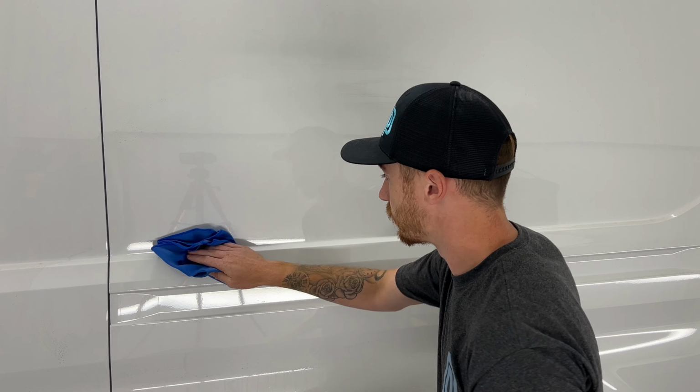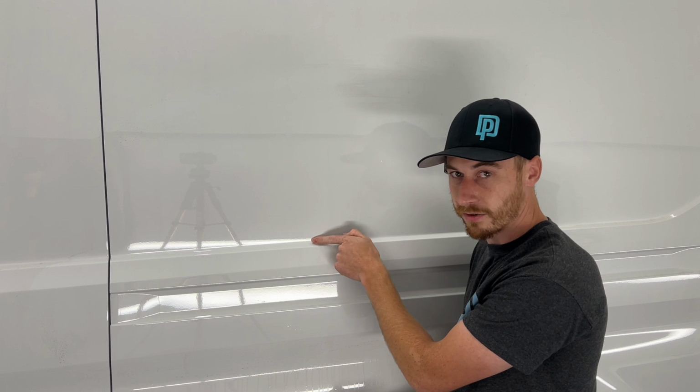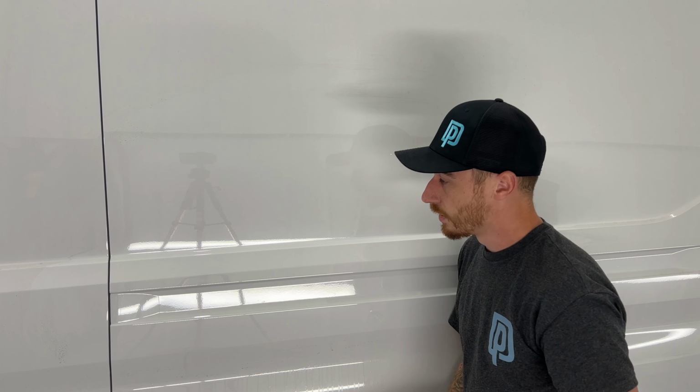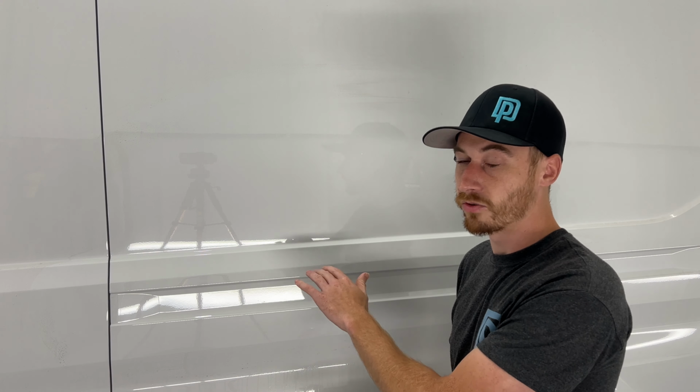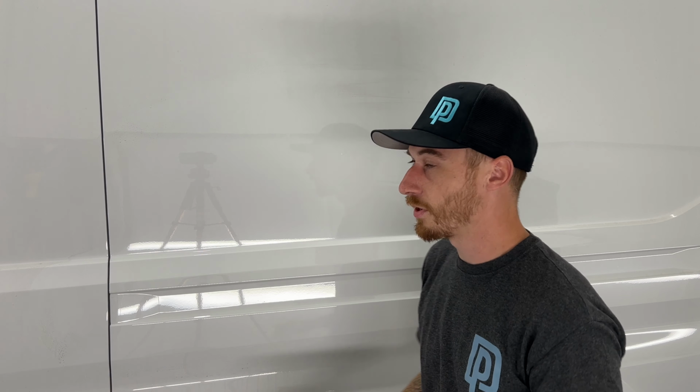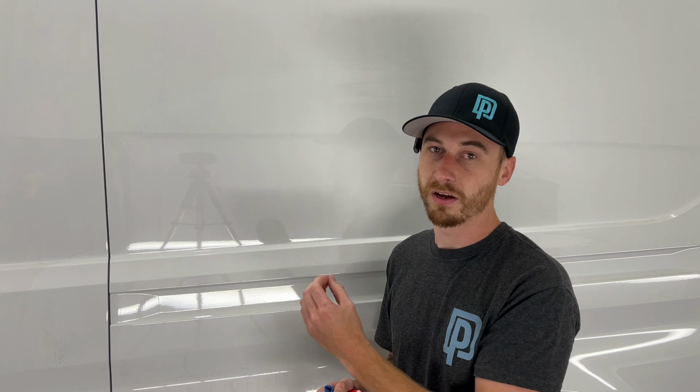Really make sure you're getting into those, because this is the highest fail point on these vans, along with these channels here. Now, one of our next videos is going to be showing how to wrap these channels so that they do not fail. But your prep is a big part of making sure that your wrap is going to last. If it is not prepped properly and there is still wax or debris or anything like that left behind, or you just didn't get that alcohol clean done properly, there's a higher chance of failure. So that is the basics of how to prep a vehicle for a wrap.